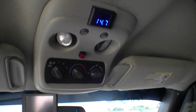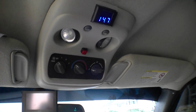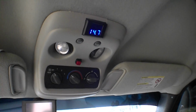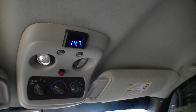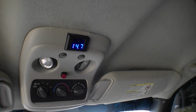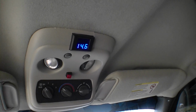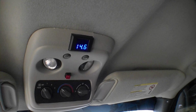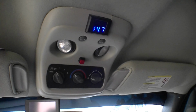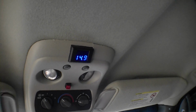That's a 300 amp alternator that I'm running. I had dual 300 amp alternators. So it sucks, but they really don't put out a whole lot of power at idle. I kind of wish they did, because I like to actually play my music, park it and just let it hit. I'm not much for sitting in the lanes with my engine roaring. So output at high RPMs really doesn't matter to me. I'd rather have something that's beast mode around 500-600 engine RPMs.